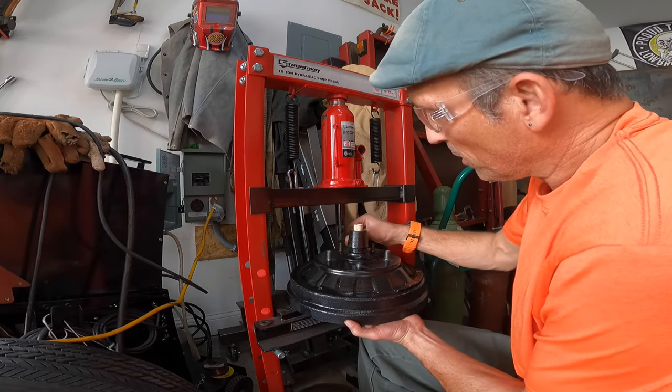Is the old design really that bad? Not really, because if you were redoing your brakes back then, you'd probably want to pull the hub anyway and re-grease and check the bearing inside. I've got the bearing packed with plastic bags right now just to keep crud out while I'm working. I will take it out, clean it, and re-grease it before I install it. But for now we're just working on it as-is. I have to make a jig to hold these so I can drill them all out, and I have to grind flat spots in all the studs.